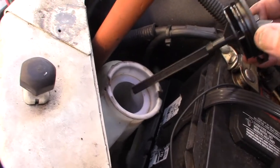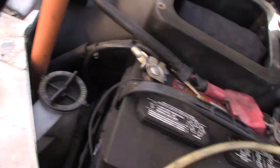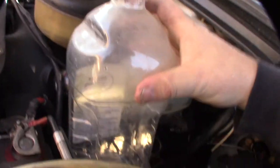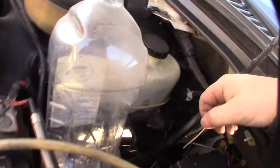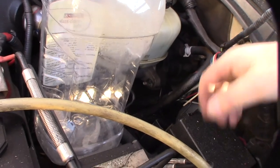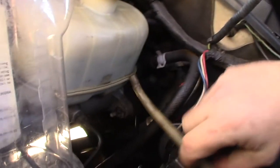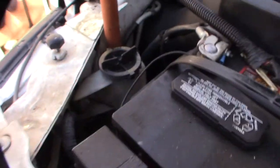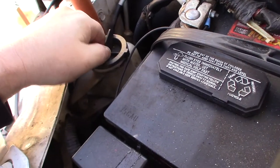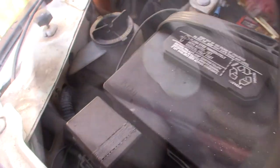It's a little bit low, but I have a little catch can here. Clear is better so you can see when to stop, because this stuff is expensive — eleven dollars a quart. A clear hose is good too. Take that off, pop that on, start the engine and start turning the wheel as you add fluid. The main thing is you don't want the fluid reservoir to ever go dry, so keep adding it as you flush it through.